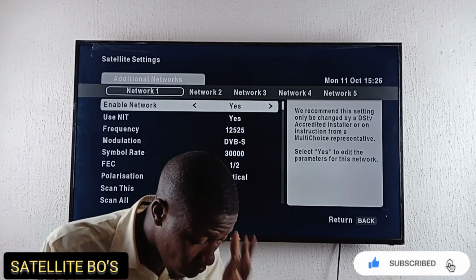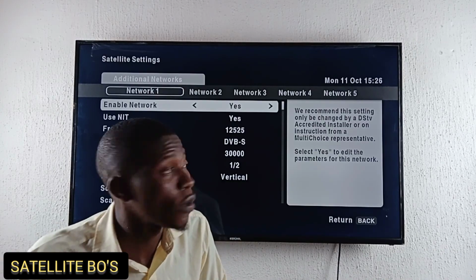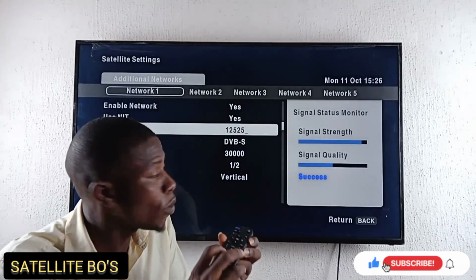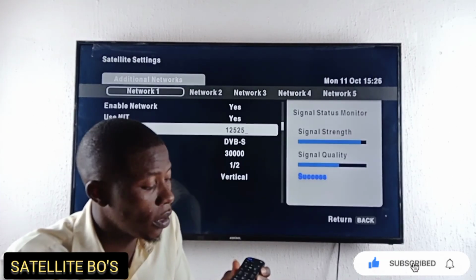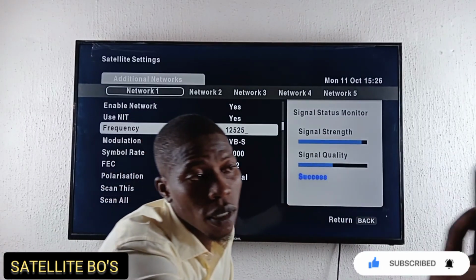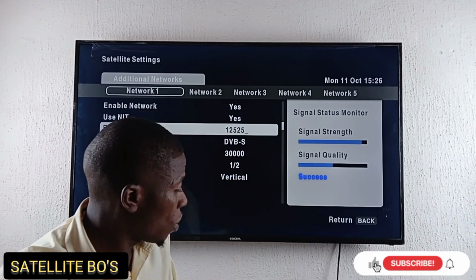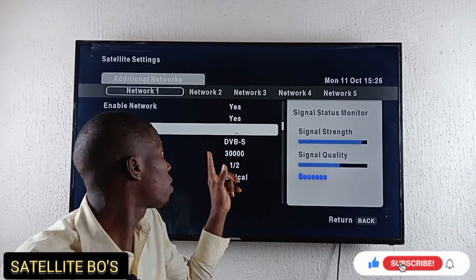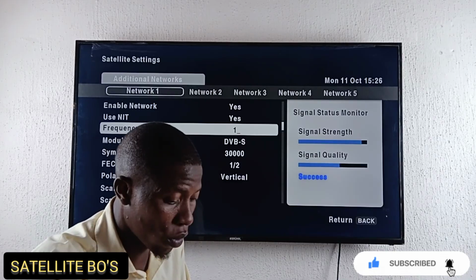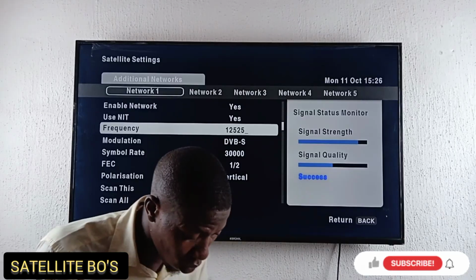My remote refuses to change frequency number. I don't know, maybe your remote might be faulty. But if your remote is not faulty, then I think the problem here is you have to come down here. See now, if I'm trying to press a figure, it will not input it. So what I do, you see this back arrow key? You press it back. Well, you see, it has removed everything that was there. So now you can input your new frequency. All right. Yeah, I think I've answered your question.